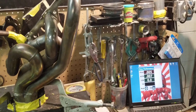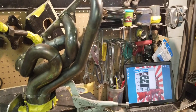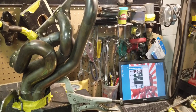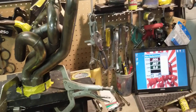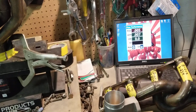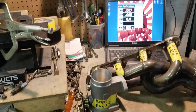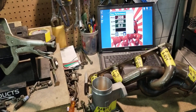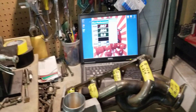Once you do, you'll feel the difference. Most of the time you can slap these on with no other modifications on a mass airflow sensor car, and it's going to read better efficiency on the intake due to the better scavenging effect and exhaust flow on the exhaust side. That's going to create more torque and more horsepower — especially give you more RPM for your peaks. Couple that with our Stage 2 Ported Explorer GT40 Manifold and our porting on this customer's throttle body, and that will wake up a small block Ford significantly, because they suffer airflow on both the intake and the exhaust.